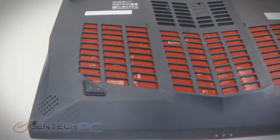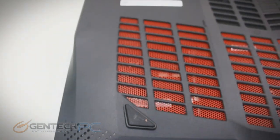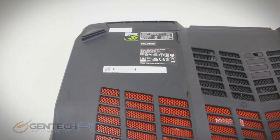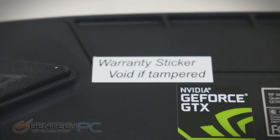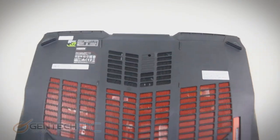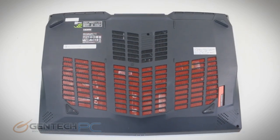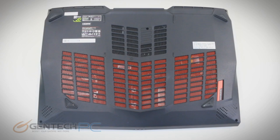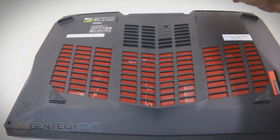To take apart this laptop we have screws in all of the corners you'll have to take out. And also a friendly reminder that this is a warranty-voiding process — so if you take apart your laptop when it's brand new, you will void your warranty. That does not mean you can't upgrade your system, because if you order it through us, we can actually cover any upgrade you would like and have it still covered under warranty. In total we have five screws to remove, which is not too bad. They are the same size so you don't have to worry about getting those switched up. Once you've done that, you can just pull the bottom panel right off.